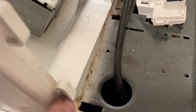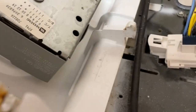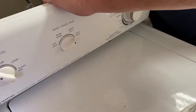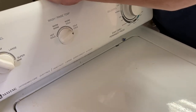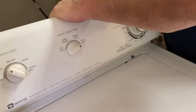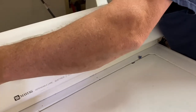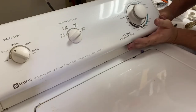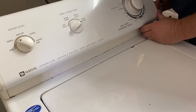As you see how they're kind of angled here, like a little foot — when you get it pushed in, you're going to slide it back, and that's going to lock that in place. We're going to lift this up and pay close attention to make sure we don't pinch anything, because there's like a vacuum line and some wiring here. We're just making sure we don't pinch anything, cause it could cause an electrical fire. So we're in. Now we're just going to give it a little push back. There we go — you heard that pop on that side, and this side here looks like it's back as well.